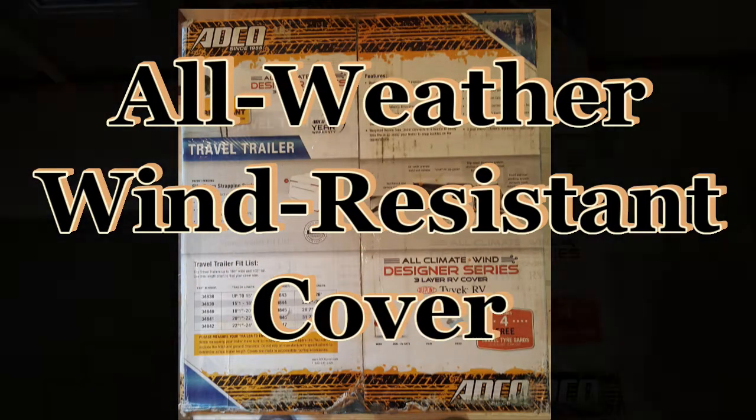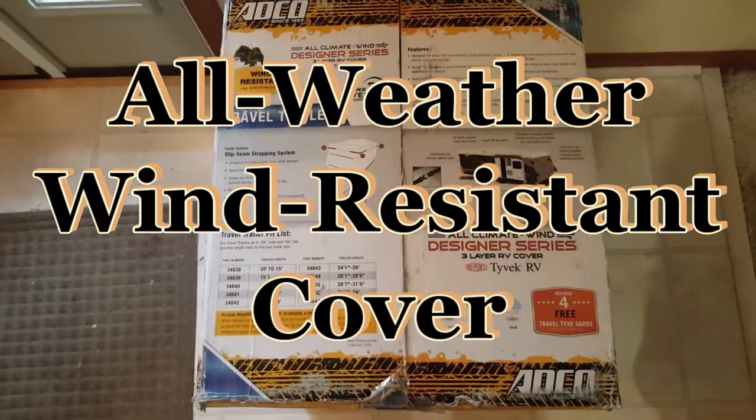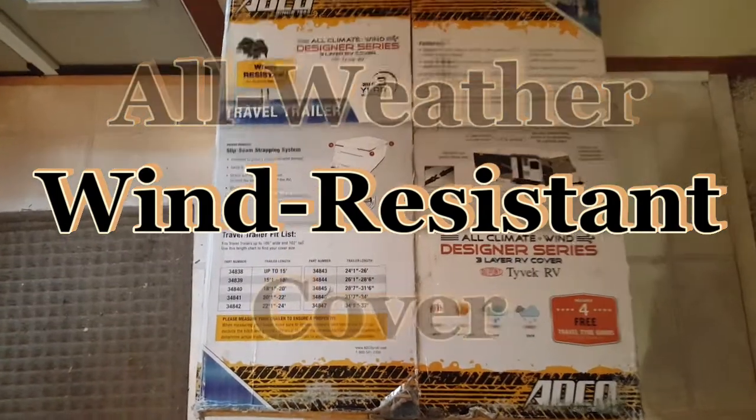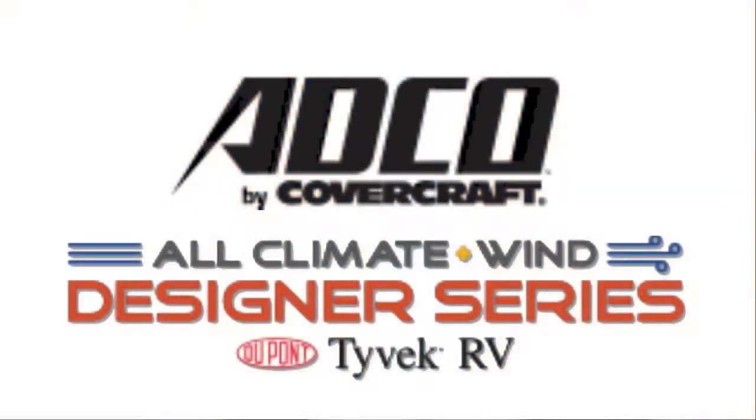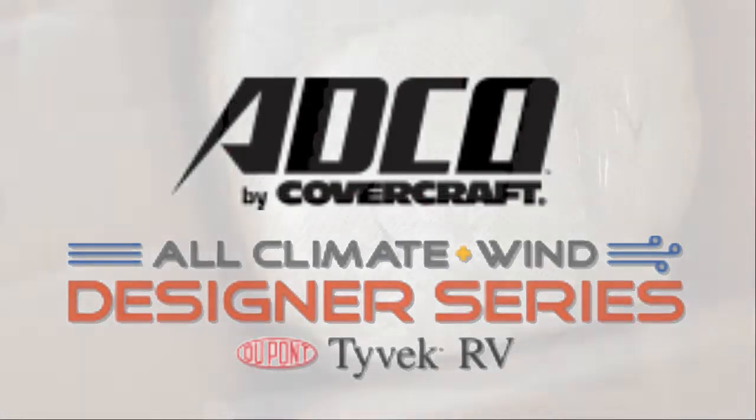The last step in winterizing the RV is to install a protective cover that's appropriate for your climate region. In my region, we get very strong winds and a lot of snow in the winter, so I need a heavy-duty cover that's wind-resistant and has multiple protective layers, including a Tyvek roof layer that will support the extra weight of the snow and prevent any melting runoff from leaking onto the roof.